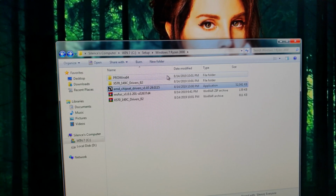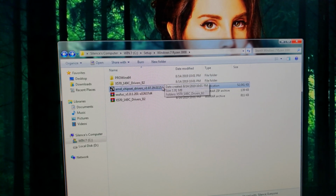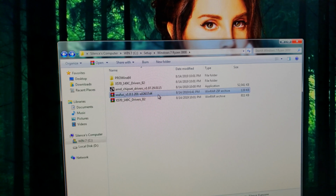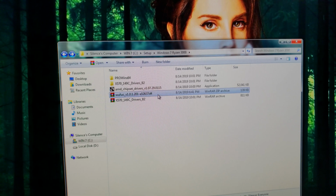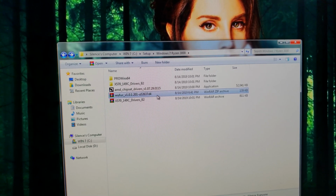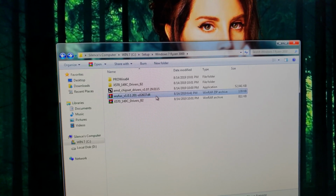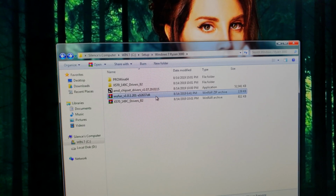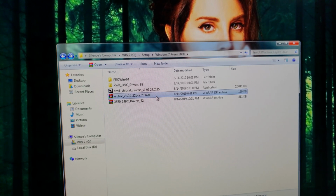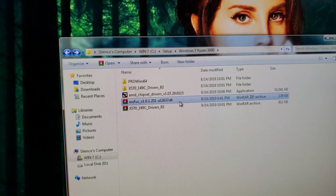Another thing you want to have here as well is that file. If you are going to be doing Windows 7 updates after you do successfully get this working, you want to get that tool downloaded. I'll leave a link in the description below to basically bypass the unsupported hardware message that happens when you have an unsupported modern CPU and you are running Windows 7, so it blocks you off Windows updates. So that's definitely something to download as well. Not necessary before installation, but might as well just get it out of the way. The chipset driver is obviously very, very important to have right after installation.